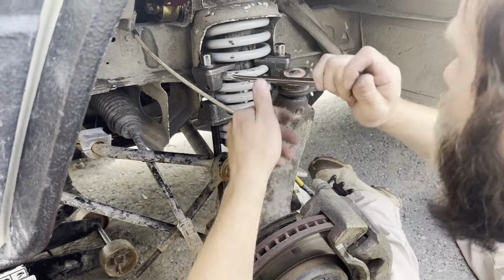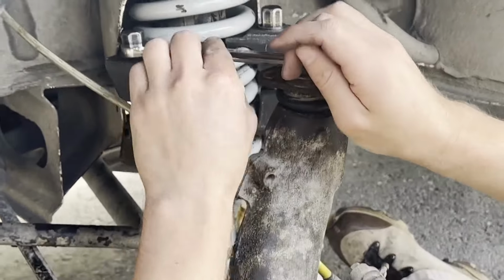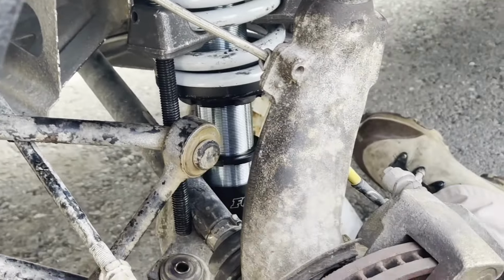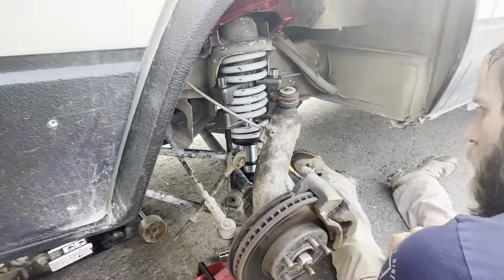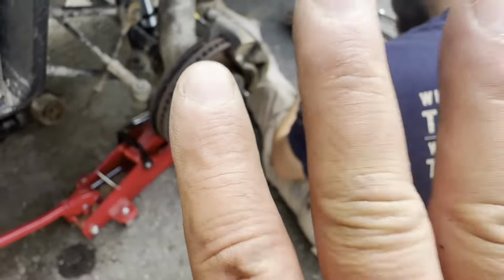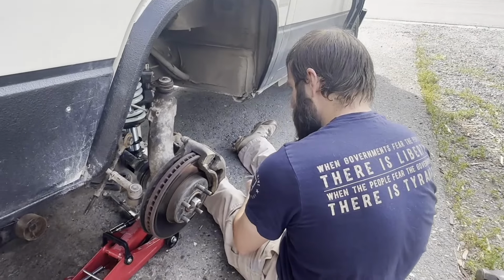Day 4, still wrenching. You're having to recompress the springs to get the lower part of the shock to adjust down because it's adjusted too high. That was why we're 4.5 inches high instead of 2. Don't use the GoWesty 2.5 Fox shock adjustment because it doesn't work with this particular Fox shock. Anyhow, we're making progress. It's just a lot of missing skin, like right there and off the back of the knuckles. So we're having a good time so far. But Drew's loving life. Progress.